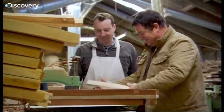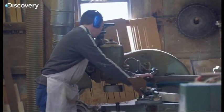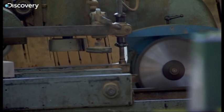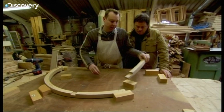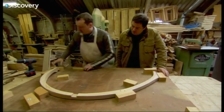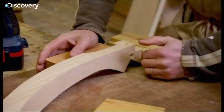The edges are trimmed and you get an idea how the finished arch will look. Now we put it into this jig to complete the wheel arch — it goes in there, down there, pushed around there, with a wedge to keep everything tight. Once screwed together in this jig, that's it, because this jig is the actual template.